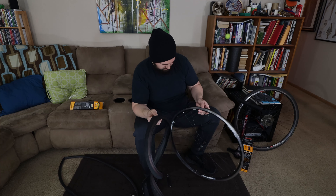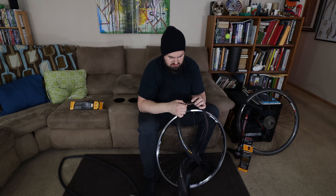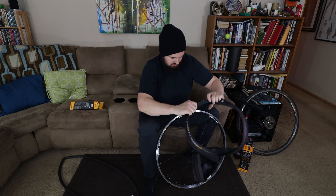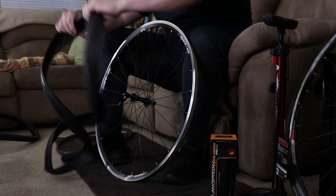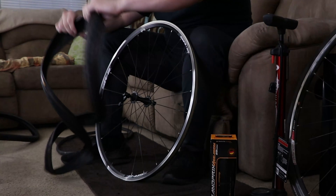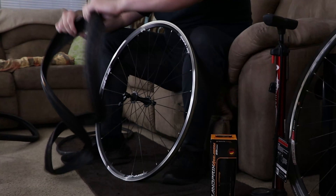When you're putting the tire on, you should find the rotation indicator on the sidewall. It'll say 'rotation' and show which direction it's supposed to go, so make sure you're putting it on the correct way. Not all tires have this, but this one does — it tells you which way it rotates because it has a tread pattern designed to go in a specific direction to get the best grip. When you get new ones, there'll also be a raised seam in the middle that will wear down over time.